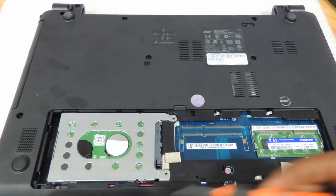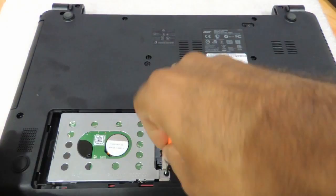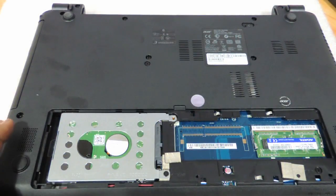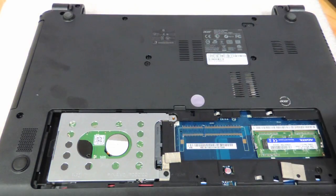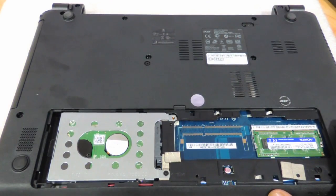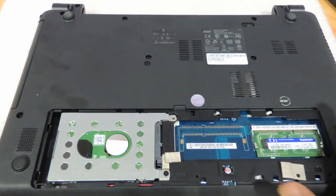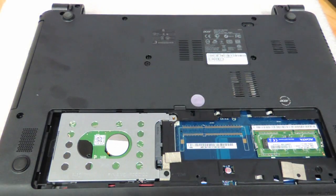Push it on the left, then put the RAM in here and the hard drive in here. So this, my friend, was the procedure to upgrade the hard drive and the RAM of the Acer Aspire E1 series — it applies for the 510, 570, 571, and 572. Any Acer Aspire E1 with a quad core processor or a fourth generation Core i3 or Core i5 needs a DDR3L RAM, and a third or second generation based laptop needs a normal DDR3 RAM at 1600 MHz. Thanks a lot for watching — do let us know your suggestions and comments, and don't forget to subscribe.